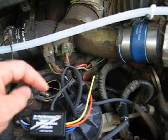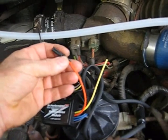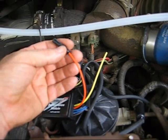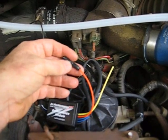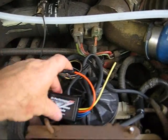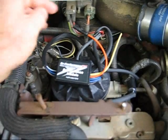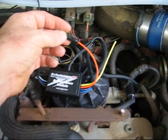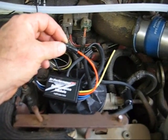The yellow wire can be wired to a switch to turn this off, so you can flip a switch and turn it off at any time. The orange wire is for a feature they never got into production — it's for a sensor off your exhaust brake. If the exhaust gases get too hot, the controller would send a signal to this chip to defuel it, basically turning it off and putting you back on your regular chip. I have a controller for my exhaust gas temperature sensor which I'm going to hook up to this, so if it gets too hot it'll turn itself off.